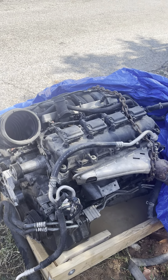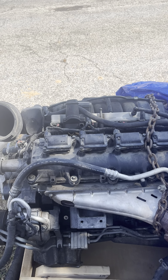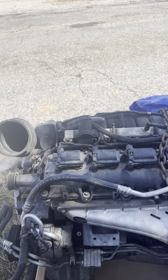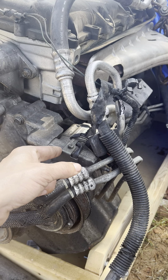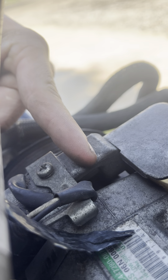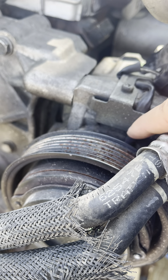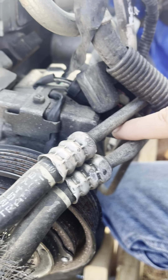Looking at this engine — it's a Chrysler 300C 5.7 Hemi with a lot of wrong accessories, or at least a couple of issues. Right off the bat, the AC compressor is gonna have to get chopped right here along this line. You can tell it's that line because on the other side you can see where it kind of divots in, so I'll cut right there across and then down and across the bottom, even with it.